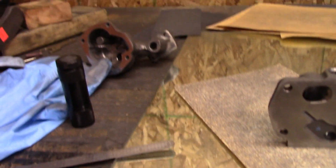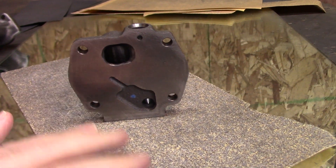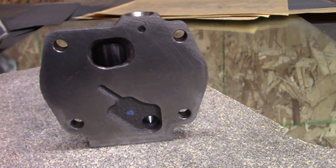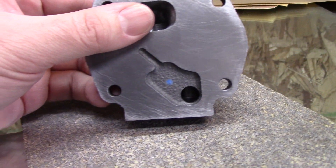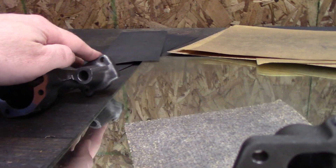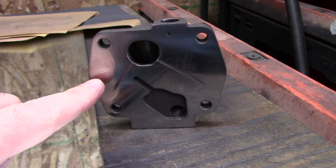Time for a quick update. I got all the porting and cleanup done, now I'm just doing the resurfacing. Here's the cap — I just went all the way down to 40 grit and as you can see it's only getting to the outside pretty much, barely touching in the center. But I don't need to touch all the way around, I just need mostly the outer strip. So this will take a minute. I've already done this side of the body, got it nice and shiny. I had to touch this up real quick because there was like a water spot right on the outside, so I decided to give it a quick touch up.